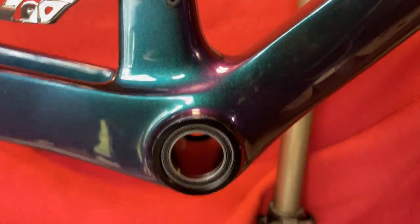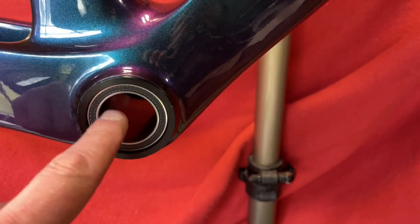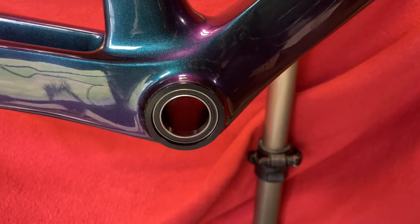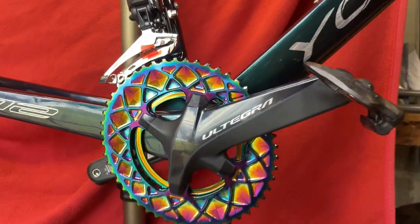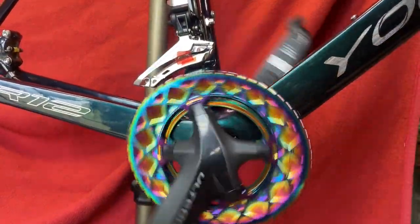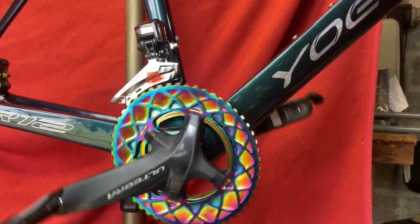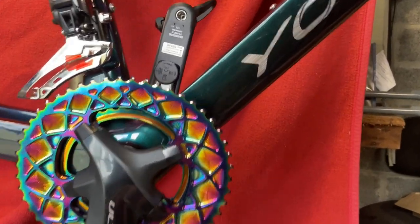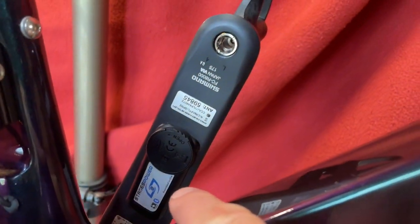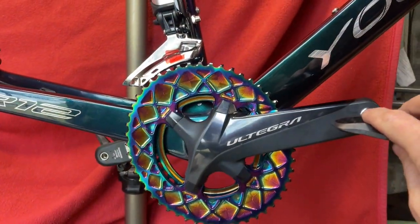It's completely one piece, sealed all the way through, so that's fine. We'll put the Delrin end caps on, then it's just a case of sliding through the crank. That is the crank on — spins like a dream. I've torqued up the pinch bolts to 14 and there's actually a power meter on the other side which links to my head unit, but we'll get on to that in another show.